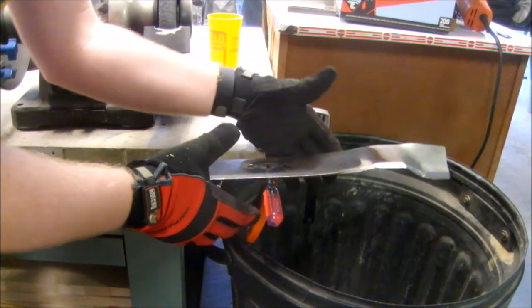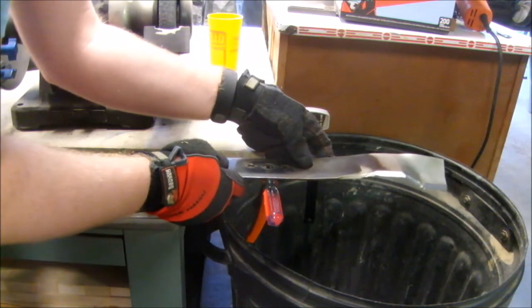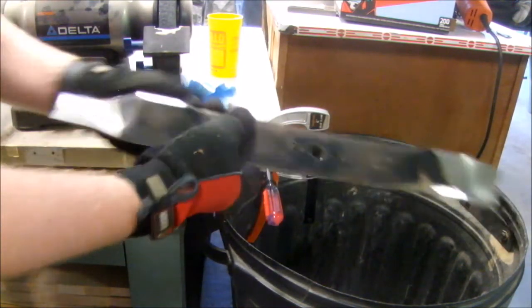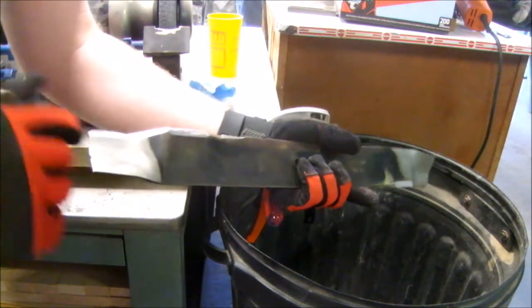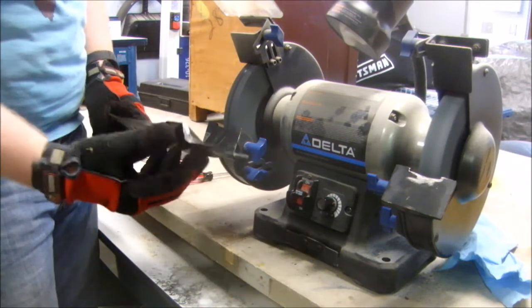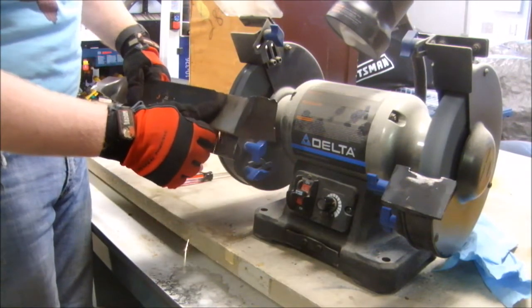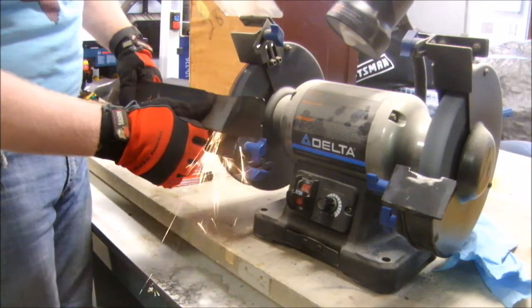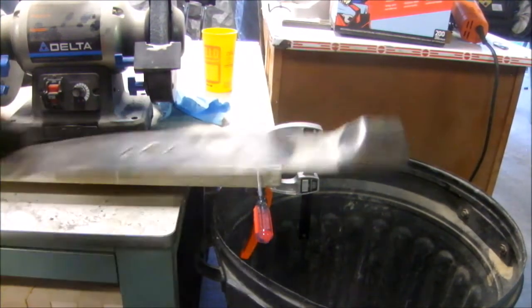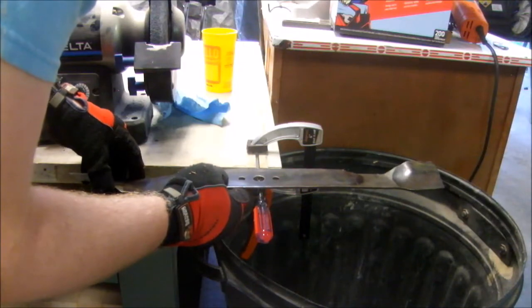But if I let it go, it tips to this side. It always tips to this side, so this is the heavy side, and I've got to try to grind a little more off. And to grind more off, I typically just go over those same edges again. Still heavy, so I'll take a little more off. So I'll test it again.